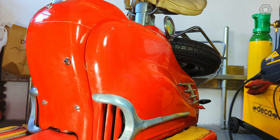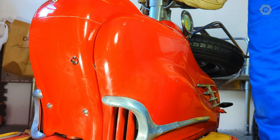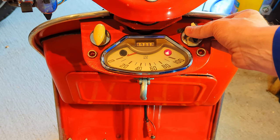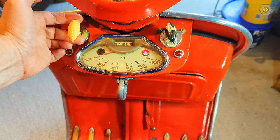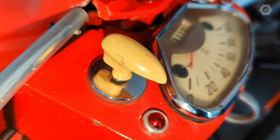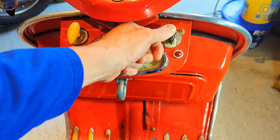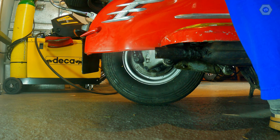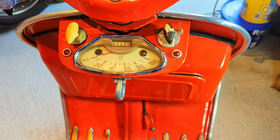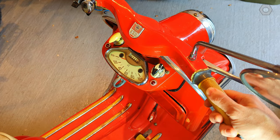Just exciting the fuel-oil mixture. The key is used for turning on both fuel and ignition. Pulling the choke and tickler knob — choke and tickler sounds like an extreme form of romance, but it's actually just an aid to starting a cold engine. Here we go. It runs — let's see if it drives.